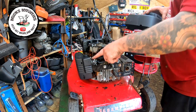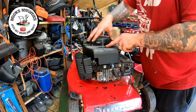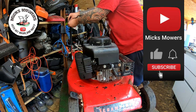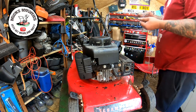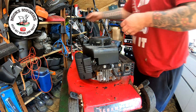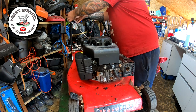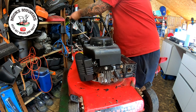So that's the pull cord now done. I've cleaned off the top of the carburettor here because it was just absolutely full of junk. The pull cord goes back on now, and all I want to do is just bring this up to the top of the handlebars, pull the pull cord up tight round so you know you've got enough tension on it, get the old pull cord out — a set of forceps would do that — then just push your new pull cord through. It's already pre-burnt off, take the slack with just a touch, and then tie a knot in the back of that just to hold it in place.